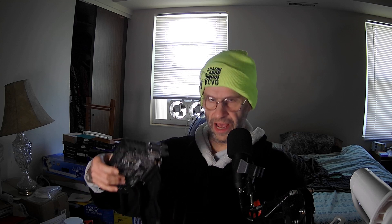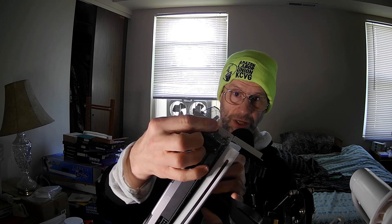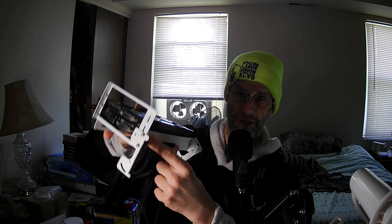Then the cable goes through. You're going to screw this into place with the two screws, and also use these additional screws. This does not go up against the slot ports on the back of your case — it sits inside on top of the PSU shroud if you've got a closed-off compartment, or on the bottom of the case. You plug this into your motherboard just as if it were the actual graphics card, using these screws to secure it at the slot ports.